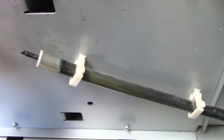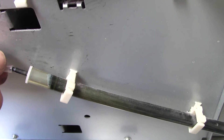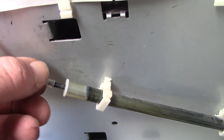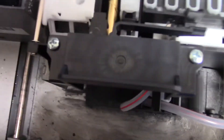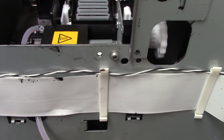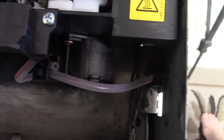Once we're done with that, pull the hose back through its slot and reconnect it to the waste ink hose. Quick double check: reconnect the side screw, the side panel screw, the hose, and make sure all the wires are tucked underneath so they're not caught by the white wheel. Reconnect your cable.